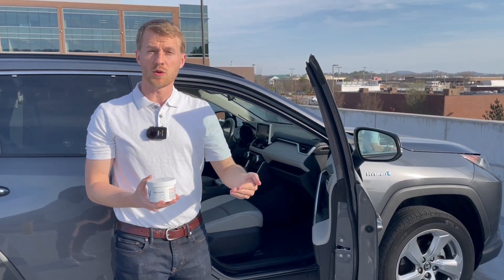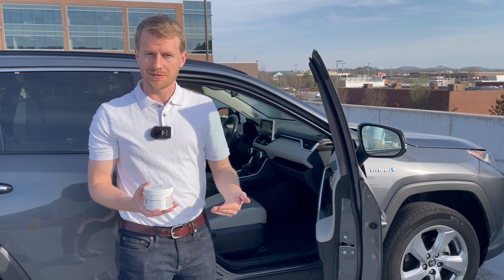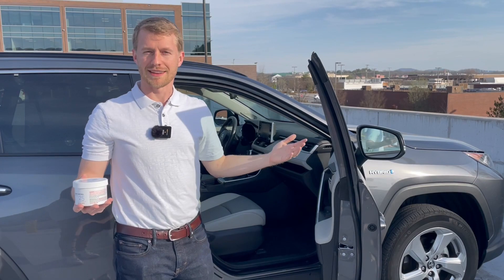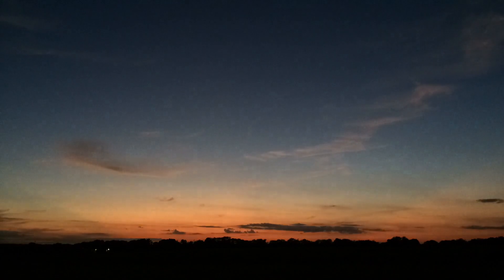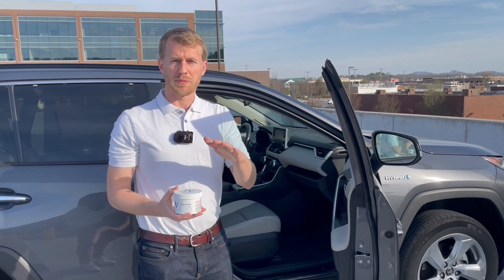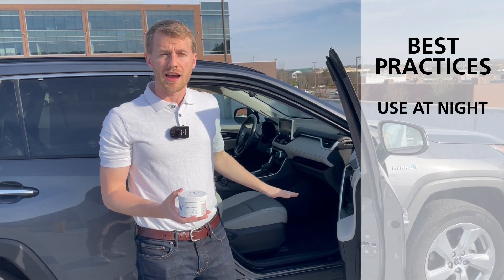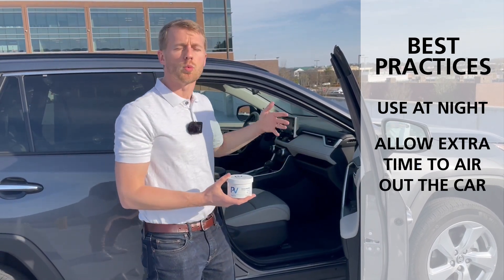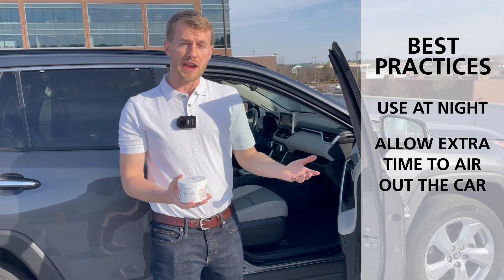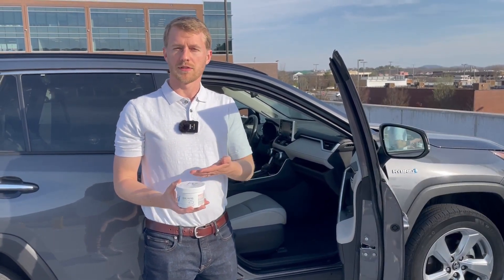Some other tips and tricks to be aware of as you're doing this PV treatment for your vehicle: we recommend doing this at nighttime. Even though we're doing the video here today in the middle of the day, doing it at night yields the best results due to UV light breaking down the chlorine dioxide gas. If you want the best results, we recommend setting this off in your vehicle before going to bed at night, coming in in the morning, opening up the car doors and windows, and aerating the vehicle for about an hour's worth of time, then disposing of the PV.